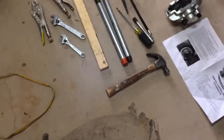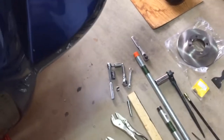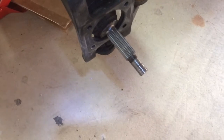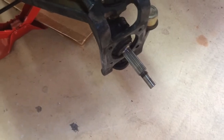Here are the tools I've used — quite a collection. Vice grips are not usually part of the game, but when you're trying to get these brake line connections loose you need a little force sometimes without breaking them. You're probably going to need a cheater bar to get this big nut off. I got one side off without it, but the other side I couldn't get it until I used two cheater bars.